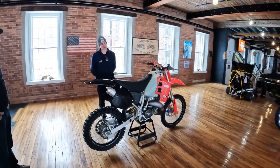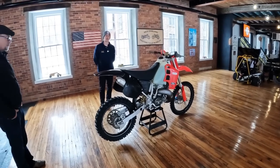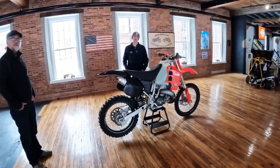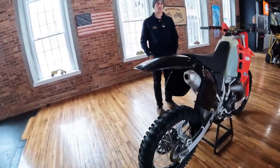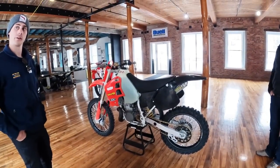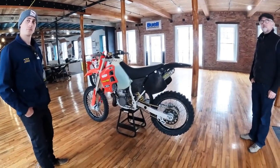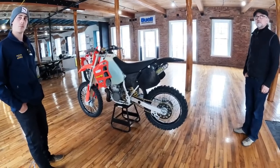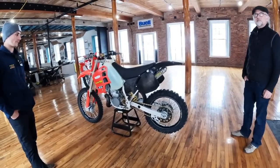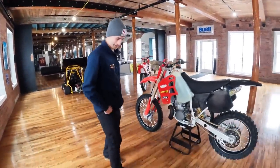Potentially we're looking at CRF forks and refreshing the shock. With stock gearing at Sand Mountain under load up a hill, you can't pull fifth gear. So we need to find top speed while being at the right point in the rev range, which is why we have to test. These things start to vibrate excessively over seven thousand RPM — that's when you're losing bolts and teeth and fillings. Definitely some Loctite in the back pocket.